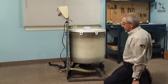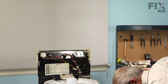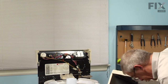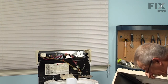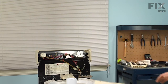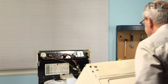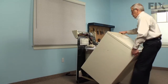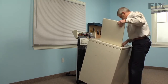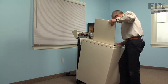Now we're ready to put the cabinet back on. When we reinstall the cabinet, note that there are a couple of slots along the rear that match up with two tabs on the base frame, and there's a lip across the bottom of the front panel that we'll hook under the front of the washer frame. The first thing we'll do is make sure we hook the front in. You can open the lid and see down through there to confirm it's properly engaged. There are also two little tabs that line the front up as well.